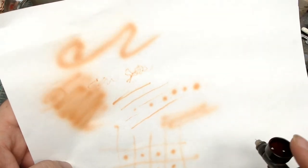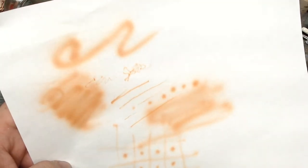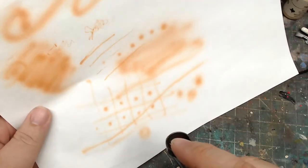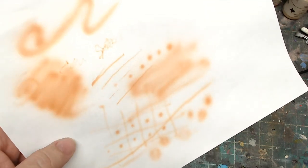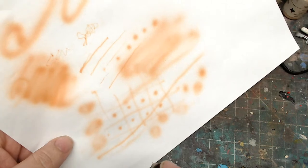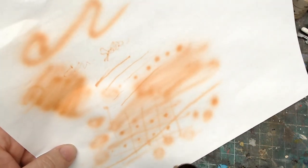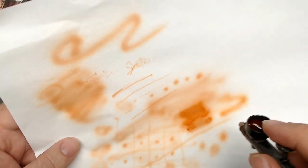It's not that common where you're holding the trigger down and going la-di-da-di-da. It's not a spray can, right? So most of the time you're like, I want a little bit here, I want a little bit there, I want a little bit right there. Maybe you might kind of do a motion like that. But the problem is, we're painting on a hard surface. So if you hover in one area too long, it's going to pool up and it's going to spider real bad and you're not going to enjoy it. So the key here is that you pretty much always want to be moving. Don't stay in the same spot. Don't try to put down a heavy coat. That's not what we're looking for.